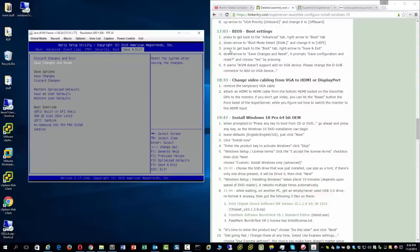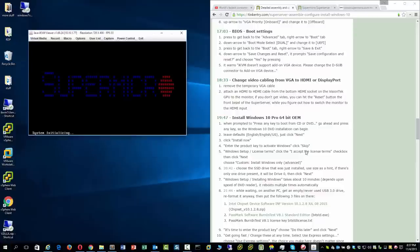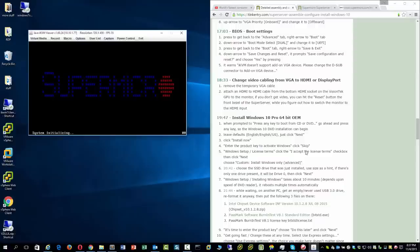Now, I didn't touch anything about the boot order. There's no boot targets with any kind of OS, other than a USB 3 key with Windows 10 on there. I used the Microsoft Windows 10 utility to create that USB key — I didn't actually bother with Rufus this time. I just used Microsoft's built-in executable that downloads the ISO file or changes a USB key into bootable Windows 10 install media. On the left side, I'll point out Samsung SSD 950 Pro 512 GB showing right there. I did not change the boot order, but I did change the BIOS type. I'm also trying to be ready for a 2TB-plus scenario. I also find dual booting with Windows 10 versus ESXi 6 works out just swell with UEFI mode turned on, and it also makes the boot target menu simpler as well.